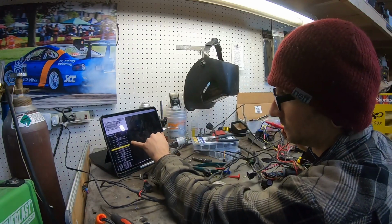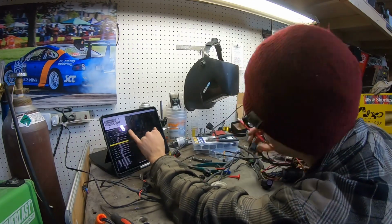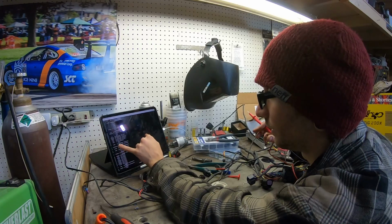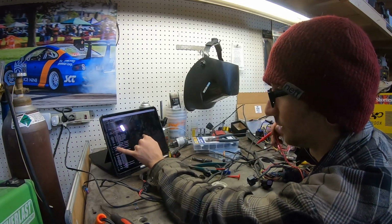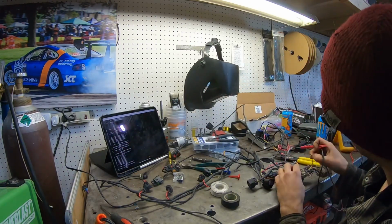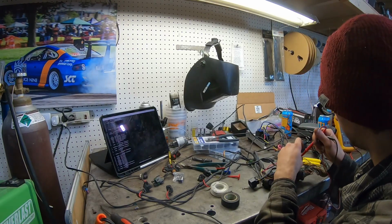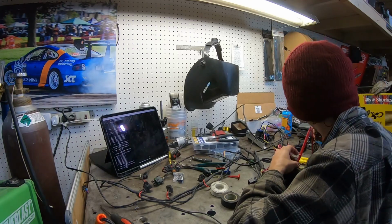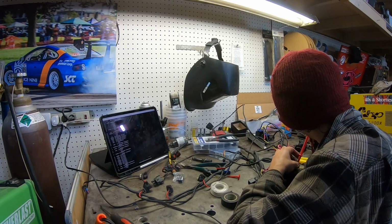Then I'm going into this diagram here, and I pull up, alright, throttle body, pin F right there, goes to pin 63 in the PCM. Now I have the wire that I pulled out of the other side right here, so pulled that one onto that. And what was that, 63? So 2, 4, 6, 61, 2, 3, it should be this pin.